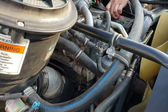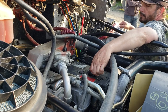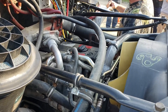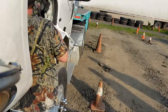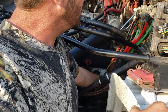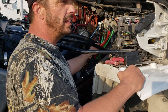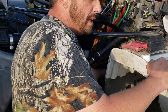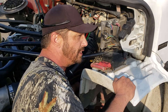My oil cap is not cracked, broken or missing. It is not leaking and is on securely. This is where I would add oil if needed. My oil dipstick is properly mounted with no missing hardware. It's not bent, broken or damaged. This is where I would check the proper operating level of my oil. My air lines at both ends are properly mounted with no abrasions, bulges, cuts or damage and are not leaking. My air compressor is mounted to the motor behind the frame. It is gear driven, properly mounted with no missing hardware, not bent, broken, damaged or leaking.